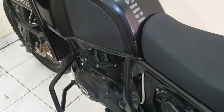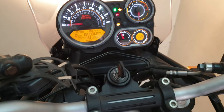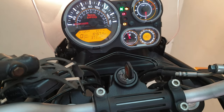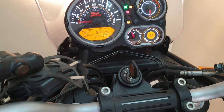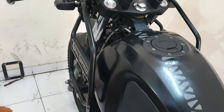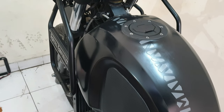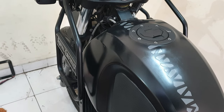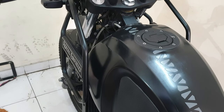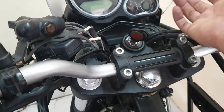Before that, there is a request for the idle setting — how to set the idle on the fuel-injected Himalayan. We have to start the bike, take it for a short ride, and then come back and start adjusting the idle. This is critical: don't adjust it at cold temperature. When the engine is cold, fuel injection is pumping more fuel due to sensors, so the idle is higher. Once you ride it, the idle comes down. Do it after a short ride of one to five kilometers.